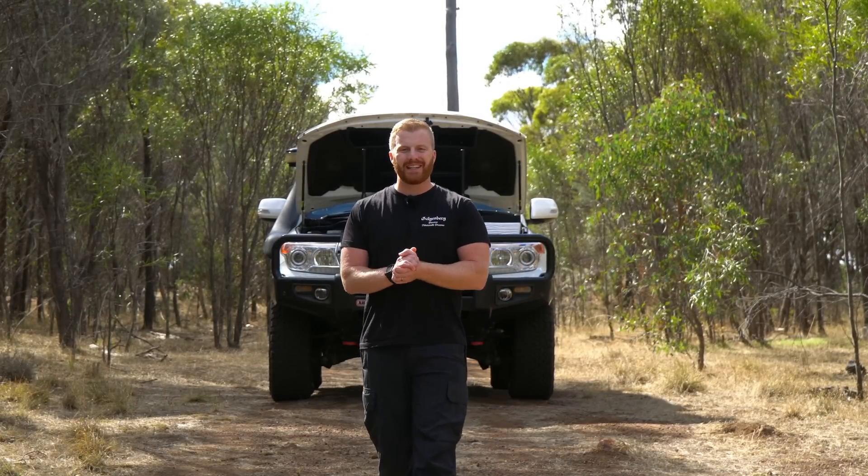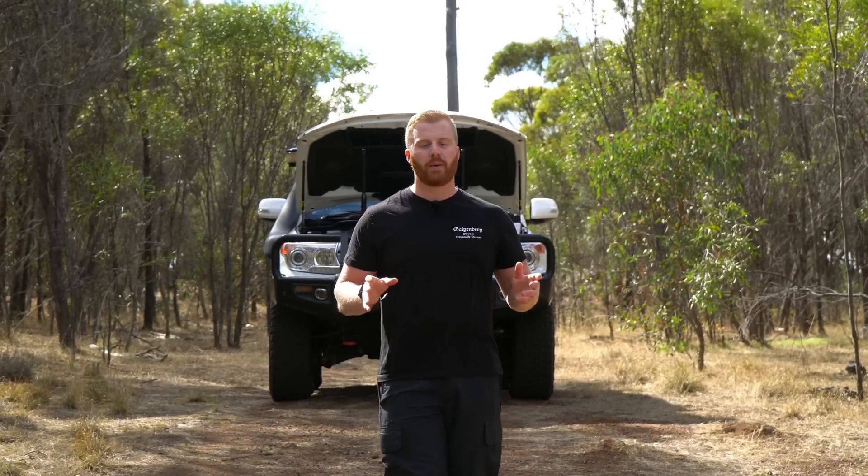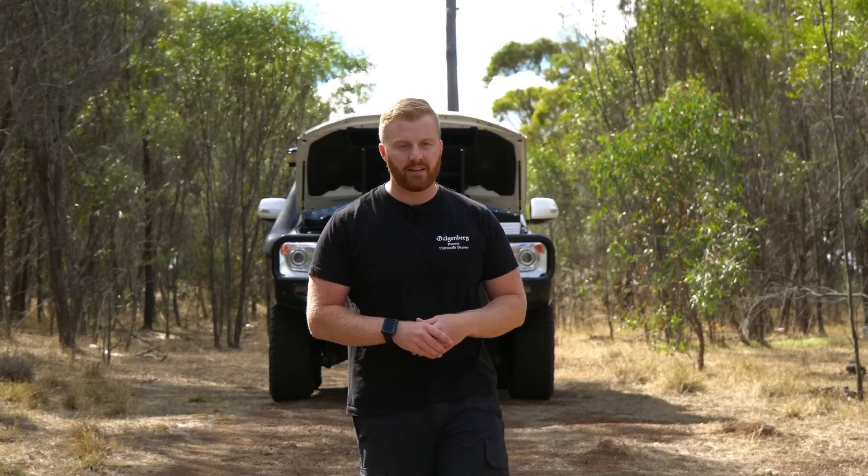That's a bit of an update on the lithium cranking battery - although out of the vehicle for now, hopefully it won't be for much longer. I should note that there are a lot of DC-DC chargers, regardless of brand, on the market these days that act in a very similar fashion. So if you have a dual battery system or are looking at putting one in and considering the lithium cranking setup, have a look at the specifications of those chargers and consider adding the relay or the Victron Smart Connect into your system from the outset to prevent these types of issues. With the recent implementation of these lithium cranking batteries, I'm sure it's only a matter of time before manufacturers offer programmable or switchable voltage input levels - but in the meantime, this is what we'll have to live with. Thanks for watching, we'll see you in the next episode.